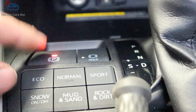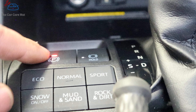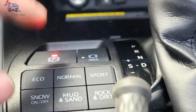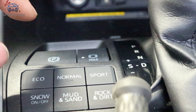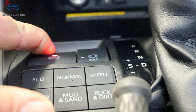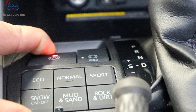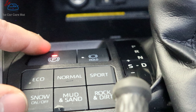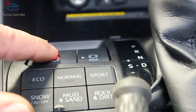Let's describe the procedure before we do it. When the light is on on the button, the parking brake is engaged. First step: disengage the parking brake, then turn the key to the on position. Within eight seconds, put your foot on the brake, engage the parking brake three times and release it three times, then press and hold it on the release. You'll do all this with your foot on the brake and the car not running, and you will hear the motor wind back all the way until it stops. Don't let go of the button.